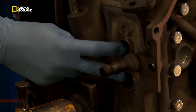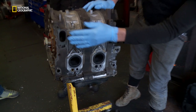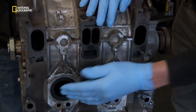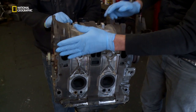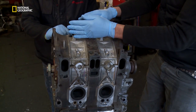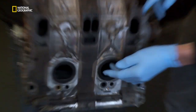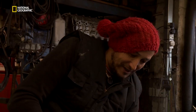So Mick, this is an engine out of another Mazda RX7. Here are the two ports where the spark plugs were fitted, on the side of the engine. At the other side of the engine we've got the inlet ports at the top and the exhaust at the bottom. The fuel and air mixture is sucked in this side, gets pulled in, rotates around, and then as the rotor goes around it pushes out the spent gases through the exhaust ports. That's really simple, and it's a constant cycle because you're running on three flanks, so it's constantly rotating all around.